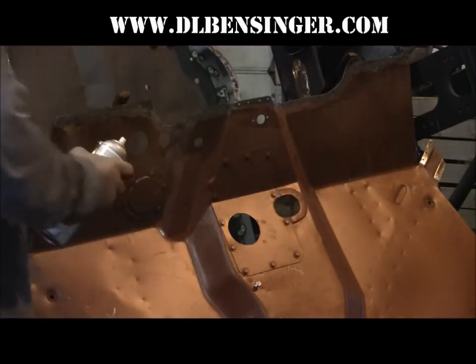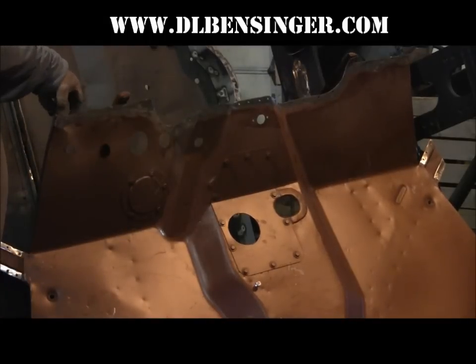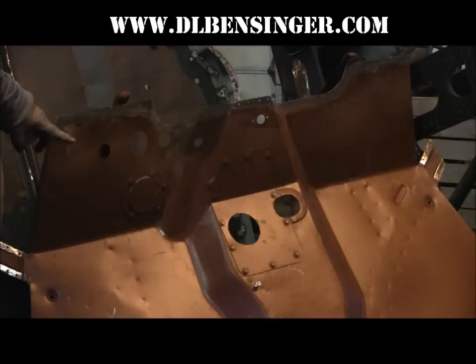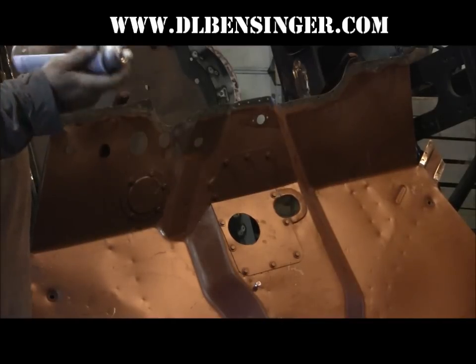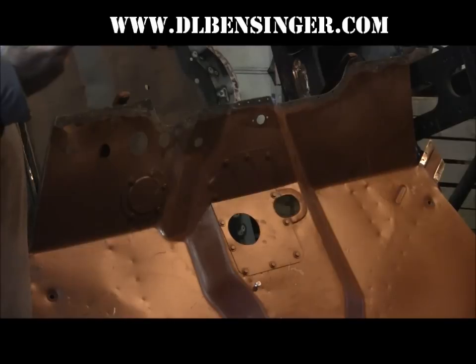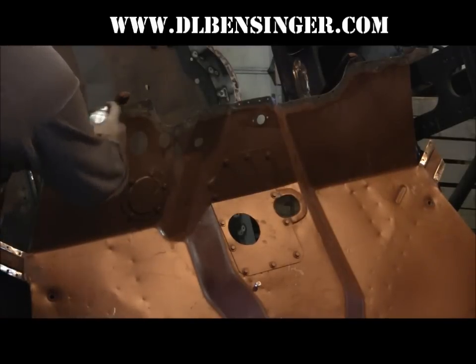Before we get ready to weld this floor pan in, we've cleaned the edges where we're going to weld it. We've gone ahead and punched some holes in there, and now with a high copper content spray weld through primer.